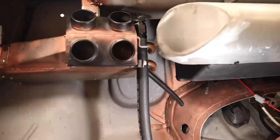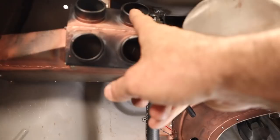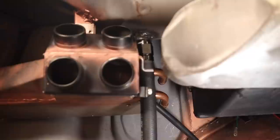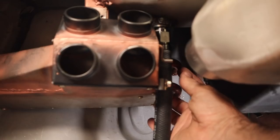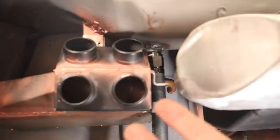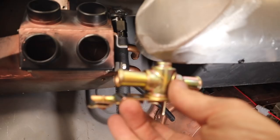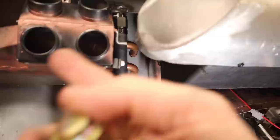I've been working for the last couple of hours trying to rack my head around how I'm going to plumb in this heater. The inlet and outlet are on the side here — they currently turn around 90 degrees facing straight towards the firewall. I still have to fit in this heater valve. For those who don't completely understand how the heater works: the coolant from your engine comes in through one side of your heater core and out through the other, and your air blows past that hot water — that's what gives you hot air in the cabin. To make sure there's not hot water in the cabin all the time, you have a heater valve — basically just a tap that opens and lets the hot water flow through and back out again.